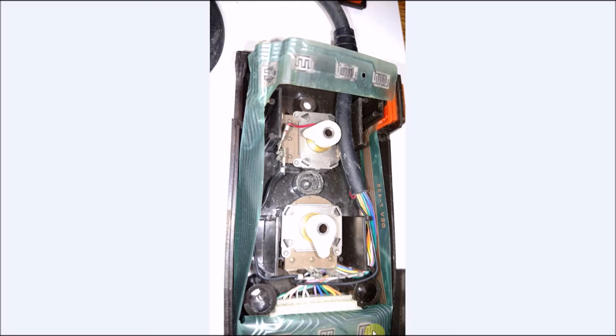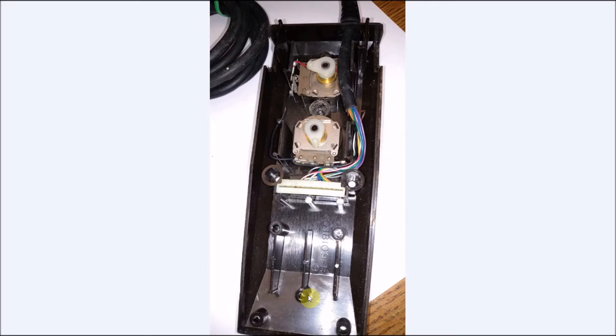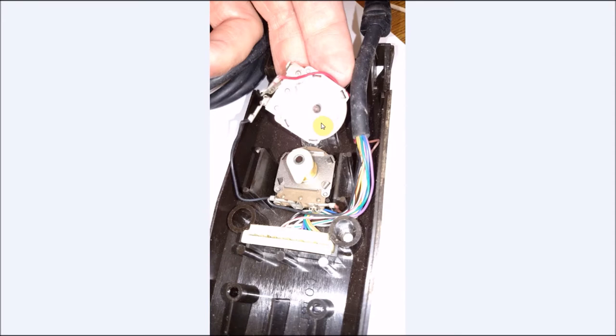There is a plastic tray down here that has three posts. So I just take a small flathead and I pry here, here, here, and here to pull this out, and it comes right out of this wire harness right here, no problem. The next thing is, again, the glue, like I said, on some of these is very loose. This one came right out, no problem. This guy was more difficult. Just take your time, loosen the glue, get under it, and it'll crackle a little bit, but it should come out okay.